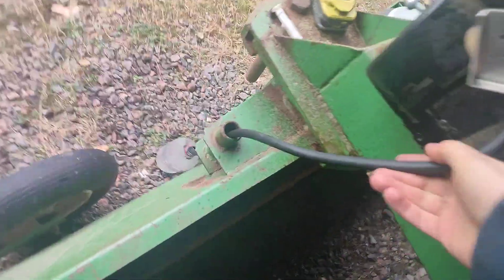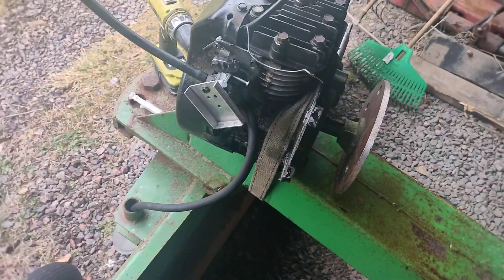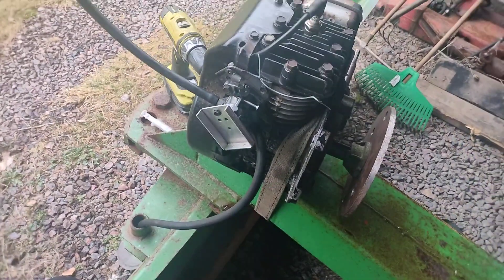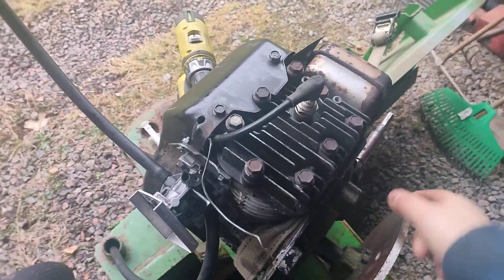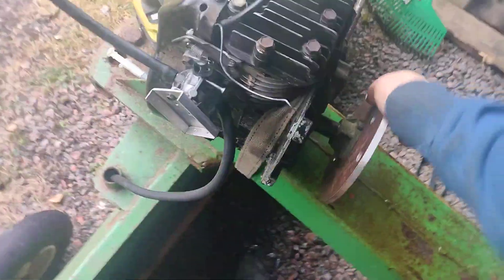You got to see it run a little bit. So let me grab the camera here. This hole is the PCV, which is running into this bottle here because it's spraying out oil — I gave it too much oil because I didn't know how much oil to add when it's being used horizontally. But yeah, it hasn't locked up yet, and it turns over really smoothly, so I don't think there are any problems. It sprayed oil all over the place before I got that hose.